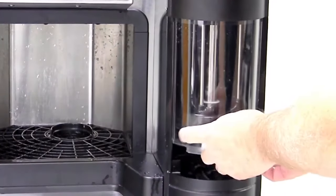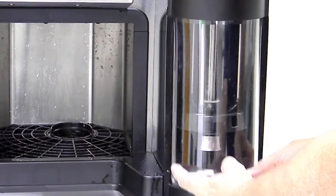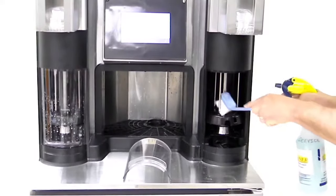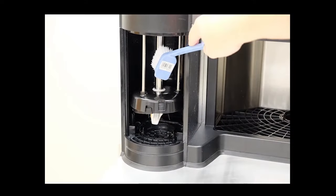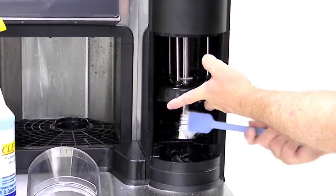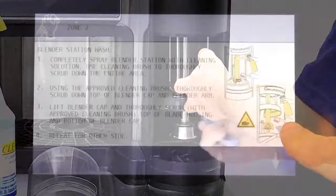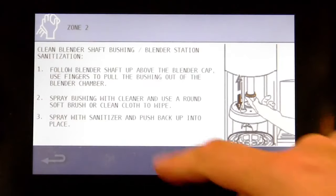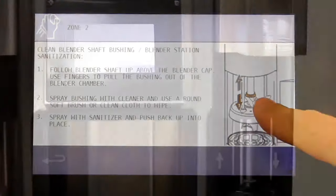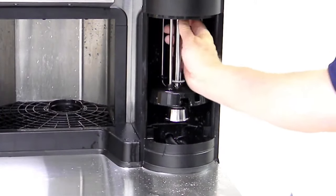Slightly open the blender door. Squeeze at the bottom of the door, tilt it out, and pull the door down and out. Repeat for the other side. Completely spray the blender station with cleaning solution. Use the cleaning brush and thoroughly scrub down the entire area. Lift the blender cap and thoroughly scrub with an approved cleaning brush — top of blade house and bottom of blender cap. Repeat for the other side. Clean the blender shaft bushing by following the blender shaft up above the blender cap.